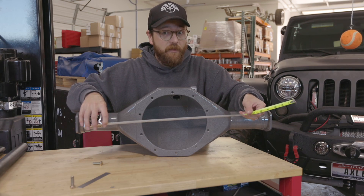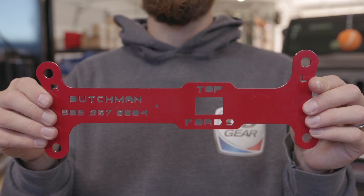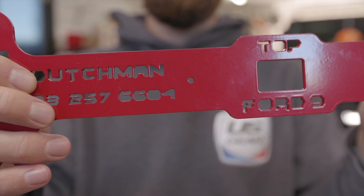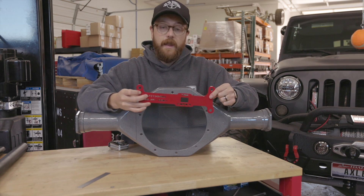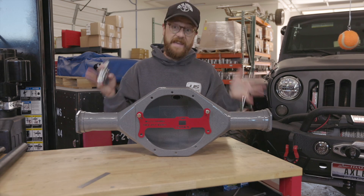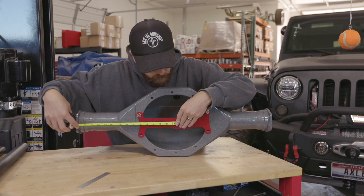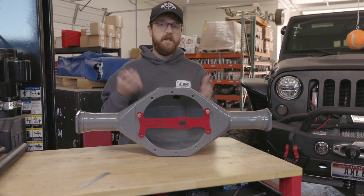We do have a little hack for you: the Dutchman dog bone measuring tool. This one is specific to the Ford nine-inch, but we make them for a variety of rear ends. They always have two measuring locations — an end-of-spline window and a center-of-pinion-line dot. Orient the housing correctly — it says 'top' — put in a couple of studs, drop the dog bone in, and it makes measuring super easy. You can conveniently measure center of pinion line and hook your tape on the end-of-spline window to pull to the housing flange, or vice versa.